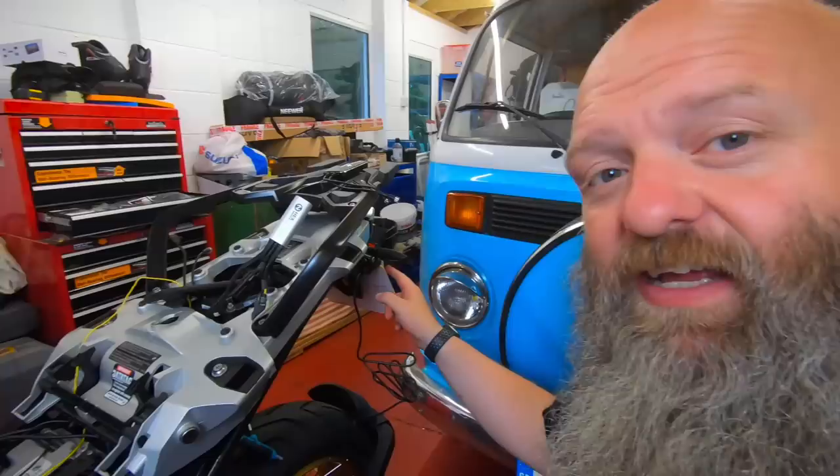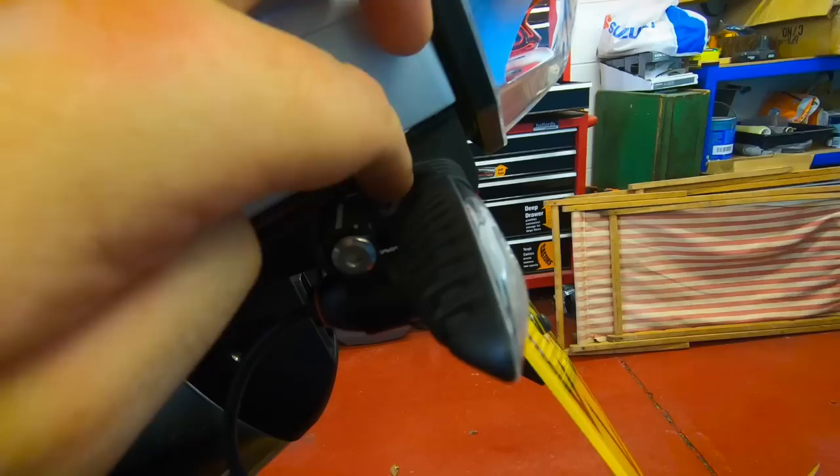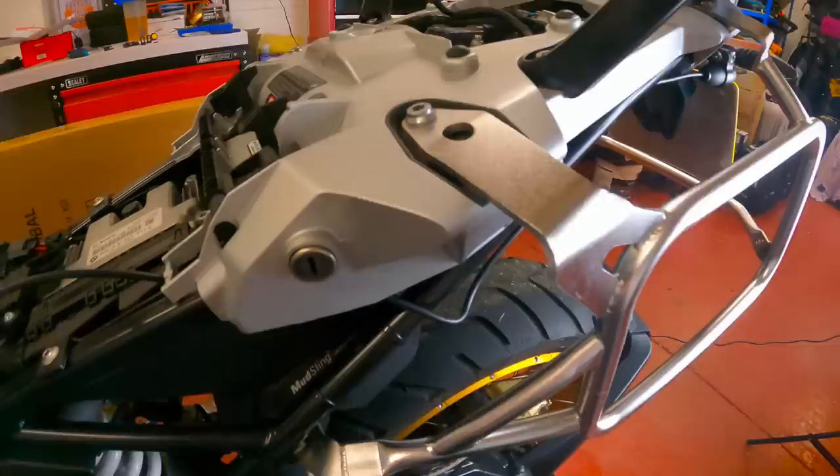Come and look at this. This is where I reckon I'm going to mount the rear camera. I've just used the existing bolt — the rear indicator bolt, a T27 torx. I took that bolt out, used the L-bracket as you can see, and screwed the bolt back in. This is all not fixed yet, but as you can see the camera just sits lovely — it fits in between the indicator and the top of the number plate. Then with the wiring, that'll all just get cable tied nice and neatly in there.